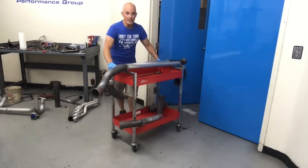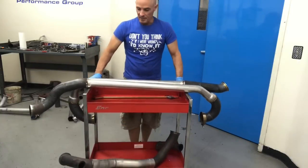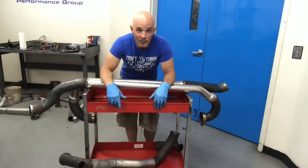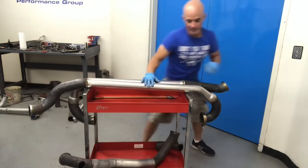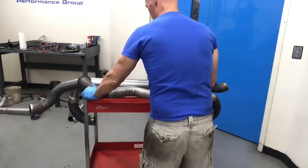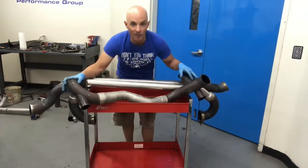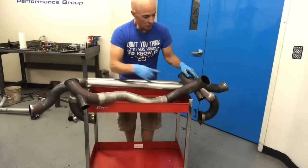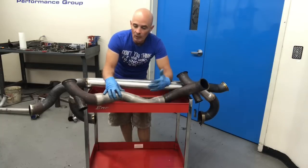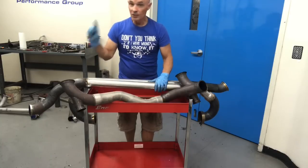So in order, the turbo kit. Okay, this is it. You guys can probably see. Custom stuff. Custom turbo kit, fresh from the muffler shop. What we did was take a wye pipe that we made previously. We used it for a bunch of stuff. We used it for a big block, we used it for a small block Ford. It's got provision for 2 wastegates, single turbo, it's a V-band. We use a V-band to a T4 or T6 adapter.